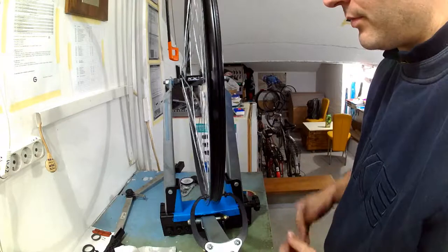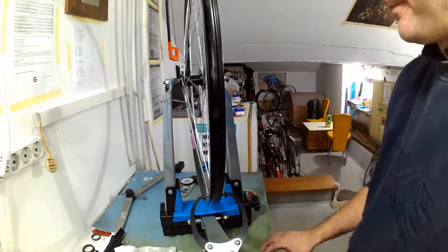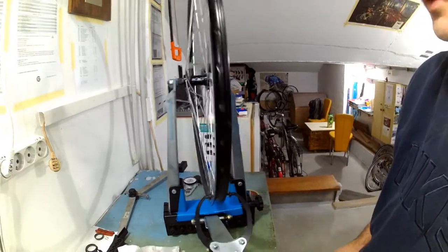It is important to note that where the rim is joined together — either by welding or another procedure — there can be a slight change in rim thickness and also in diameter, because that part is not as easily trued. Trying to make that part perfectly true can bring the whole wheel out of balance because it would require spokes being much tighter or much looser than the other spokes on the same side. So some slack should be given at the part of the rim where it is joined together, of course within some limits of tolerance.